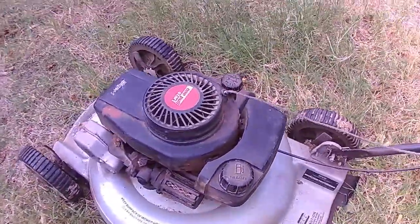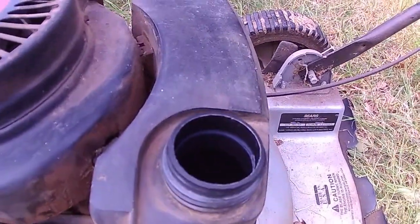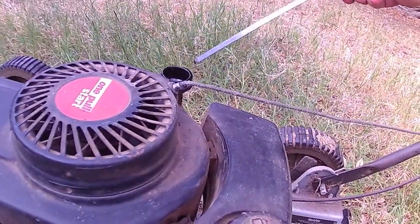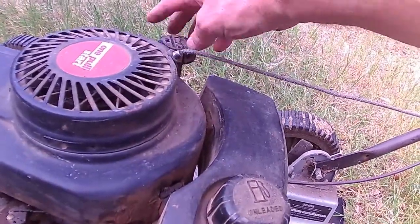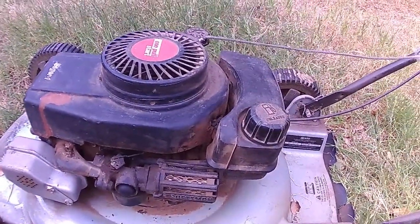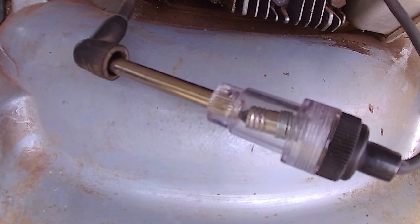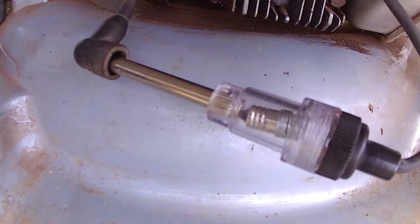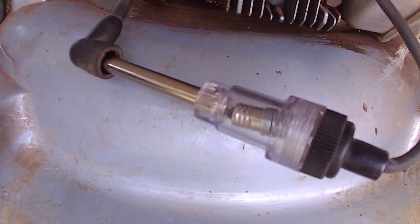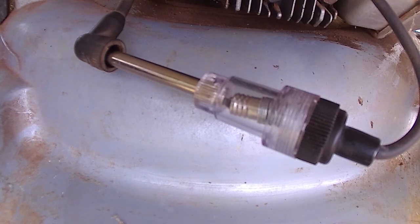We're going to go through a couple of the steps I do when I get used equipment. We'll open up the gas and check it out — there isn't any, which might be a good sign. We're going to check if there's any oil in it — there's a little bit. We'll check for spark and see if there's some compression. The clamp I had on the bail just wasn't holding right. Got a pair of vise grips up there now. We checked for spark and you saw the red flash, so we know we got spark.